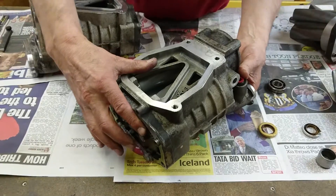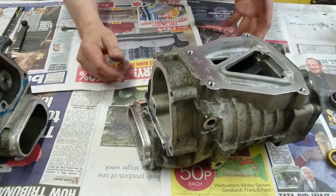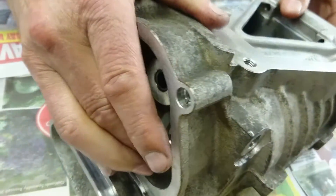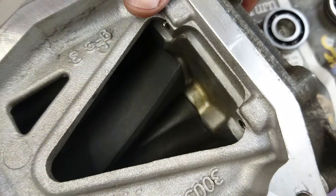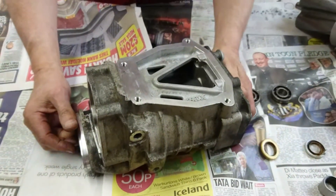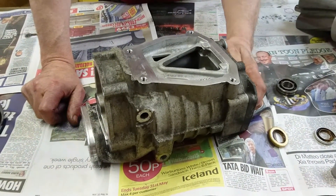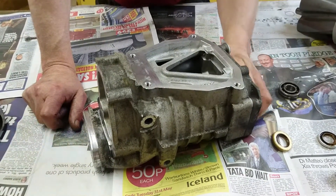This one here is one that we have just done. It's got the nose off and the PTO off, which means we can push and pull on the ends of the rotor shaft. We'll do the same test on this one — pushing on this end here, it's got our green coupler on there. We can push and pull on that one, and push and pull on this one here, and there's no noise — absolutely zero play on that at all. We'll do the same on the second rotor. Nothing at all — absolutely no end float. The actual clearance between the rotor and the casing is somewhere between 0.05 and 0.1mm, which is between 2 and 4 thousandths of an inch — about the clearance you want. Turning is nice and smooth. No rotor-to-rotor contact, no rotor-to-casing contact, none of that noise when you push and pull on the rotors.